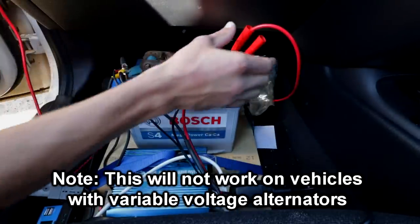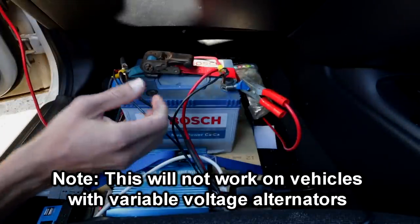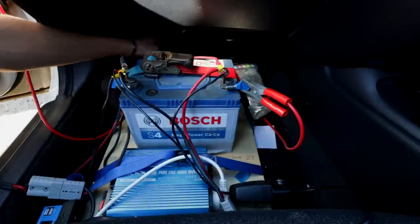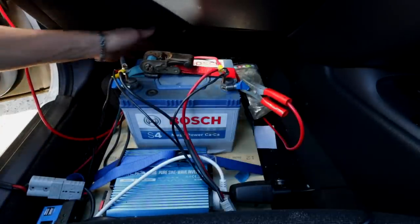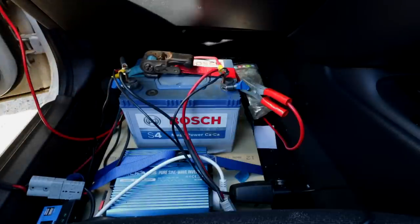When I pull up and stop driving, I park the car and just put it back onto this plastic tab. That's how I've been doing the dual battery setup. This earth here is just hooked up to a bolt up in the footwell, and that's earthed through that bolt because it has an earth through to the chassis.